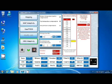Use it only if you cannot auto-calibrate a vehicle, or maybe if you need to replace a reducer and the new one has no way to mechanically regulate the pressure and its working pressure is different from the previous one. In any case, you have to check the mapping of the vehicle after adjusting these parameters. However, to recalculate the compensation, you must be on gas.